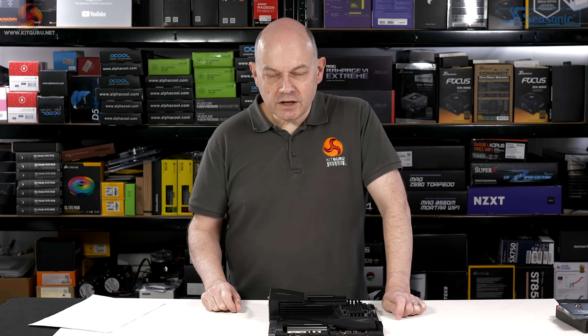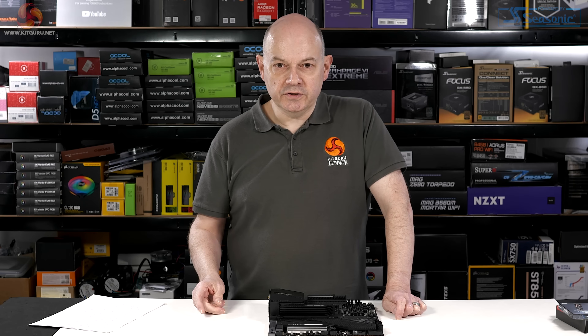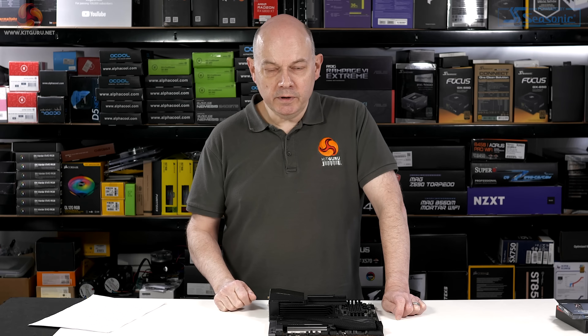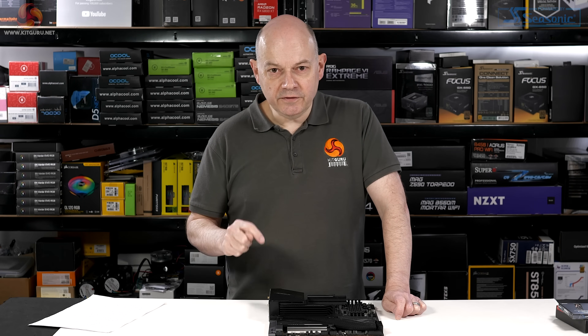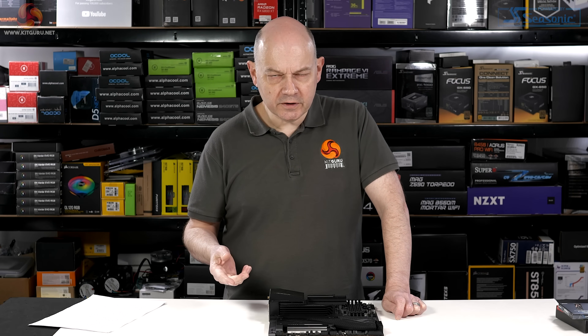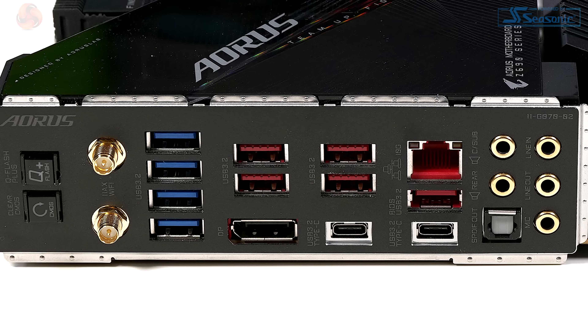We're seeing reports that HDMI is the get-out-of-jail connector. DisplayPort can be a bit peculiar — sometimes you have to boot off HDMI before you can then switch to DisplayPort. If I was going to pick one connector for the rear I/O panel for graphics, I would use HDMI rather than DisplayPort. In that sense, I think that might be a bit of a mistake by Gigabyte.